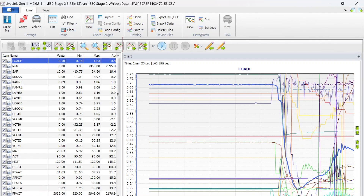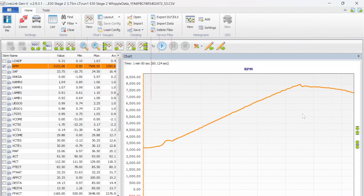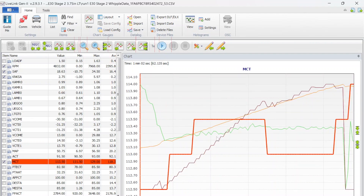SCT Live Link has its own little nuances. I'll show you real quick what I look at on a dyno run — deselect all the parameters, just grab RPM, and maximize. Now I've got a dyno pull here. I can see spark advance and correlate that with power to know if I'm making the power. I can see knock sensor activity — eventually got to a full six degrees. I can see manifold charge temp: started at 112, went up to 113, came back down half a degree. That's pretty normal on an 85–90 degree day like we're having now, unless you do a super cool-down with ice. That is how you can see in a data log if the car is making the power it should.